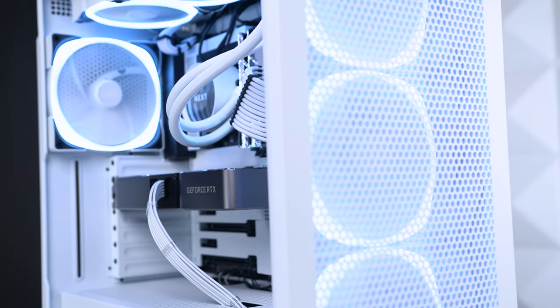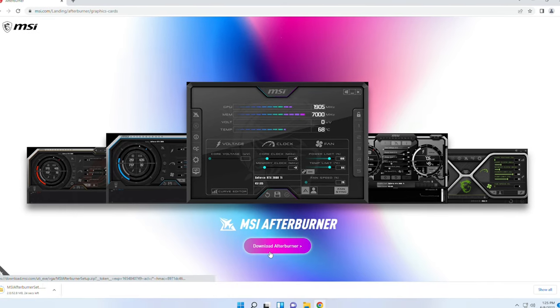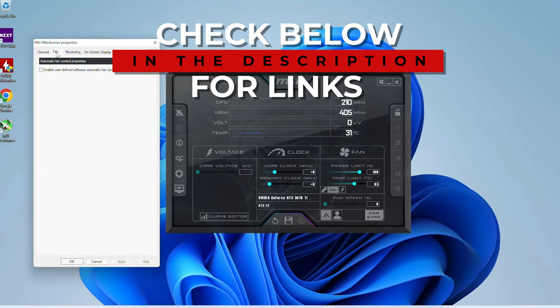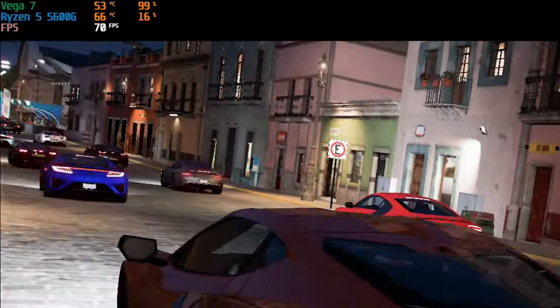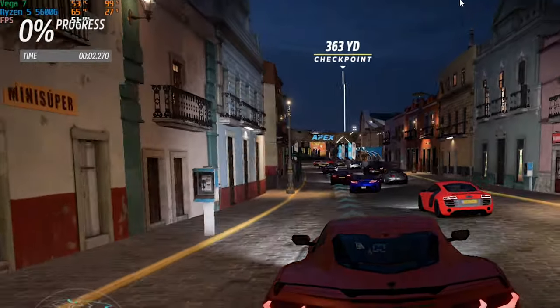We'll talk about every single part inside of here in just a second, but before doing anything, I would highly recommend you install our first piece of software, which is MSI Afterburner, because you'll need this for pretty much every step along the way. I'll have links to all of these software options and the PC components for our testing rig down in the description, but the reason why MSI Afterburner is important is because it allows us to overlay any specific metric that we want for our system over top of whatever we're running, and this is super useful when benchmarking to see things like our CPU and GPU's utilizations and temperatures.